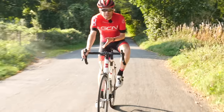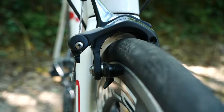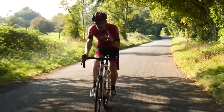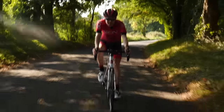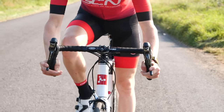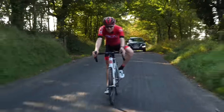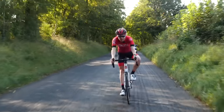At this time, with this generation Dura-Ace, there wasn't the option for direct mount calipers either, only the single mount we have here. And again, direct mount rim brakes, if your frame accommodates them, offer greater stability and stiffness within the caliper and translate to better braking than a standard rim brake. And one final point about the rim brakes is that more modern calipers are designed to accommodate bigger tires as well. In this era, 28 millimeter tires weren't really a thing on road bikes, although I reckon, looking at it, I reckon you could get one in here.